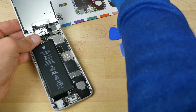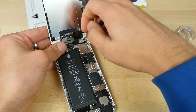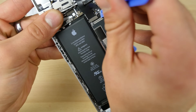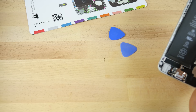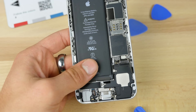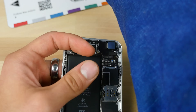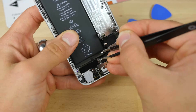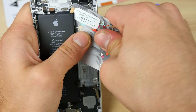I hate these screwdrivers — they suck. I just want to show you guys it's possible to do with the basic set they give you, but a good tool set makes this job so much easier. Go ahead and gently pop out all of the display tabs and it is separated, so you can set that aside. The screwdrivers they give you are acceptable, but I'm making life so much more difficult than it needs to be. I'm going to go ahead and use mine. And if the battery part fails, you go with the famous credit card failure method.